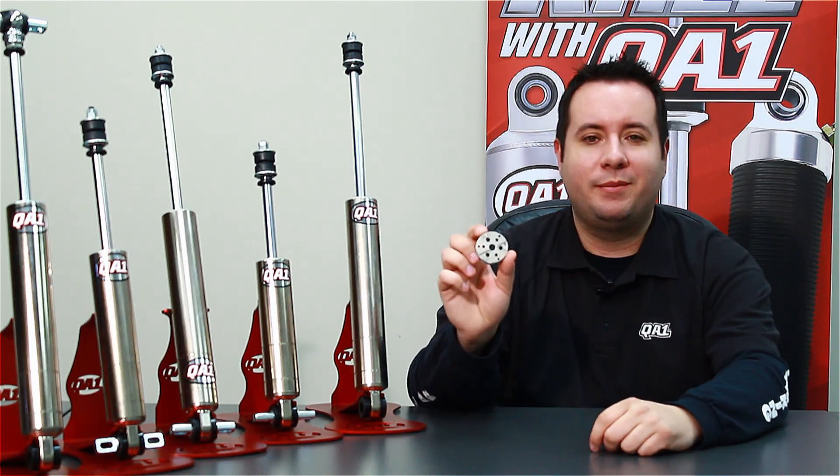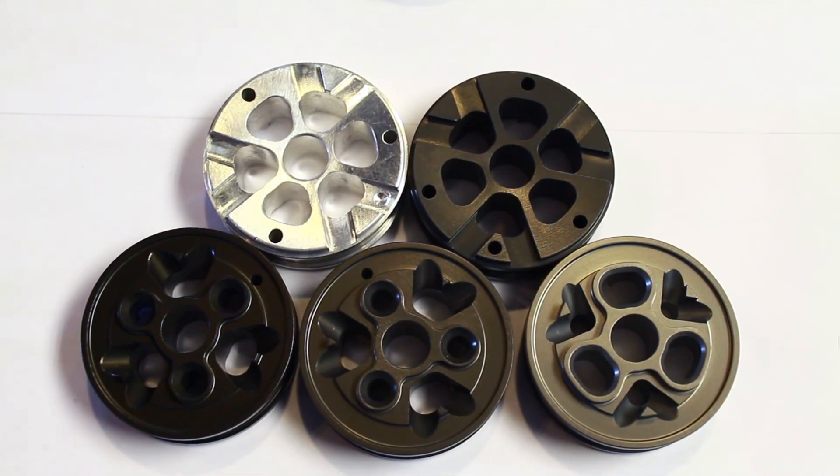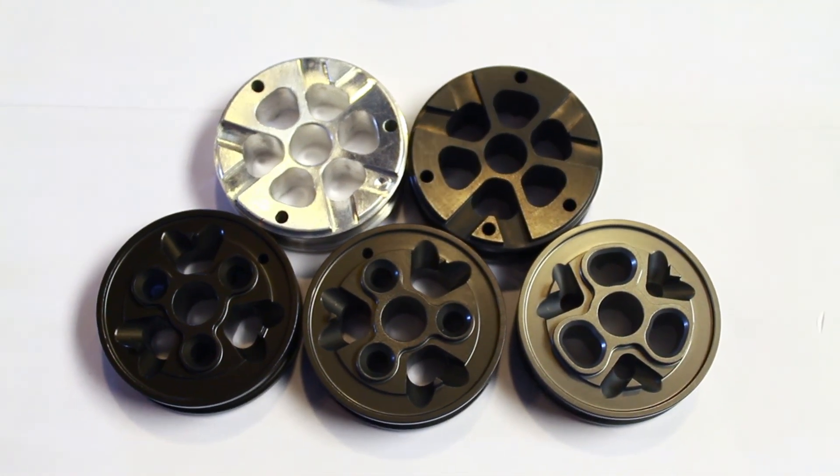They all feature our 46mm linear piston. This is just one of the five piston options that we offer. All of the shocks are available in 1-12 on compression and 1-12 on rebound. So if you have a big tie down shock or an easy up valving combination you'd like to try, we can accommodate you.